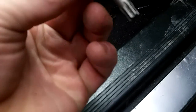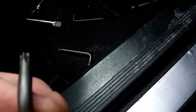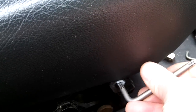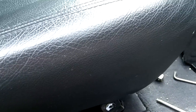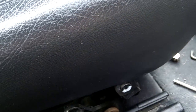Now you're going to need a T30 Torx — you'll probably need a small bent one, one of these little sets. You'll have to do the same thing on the inner part. Along the front there's a little white dot, and at that spot there is a T30 Torx screw to remove. Best to put your seat all the way up as high as you can if your power seat is working — raise that part of the seat cushion as high as possible.